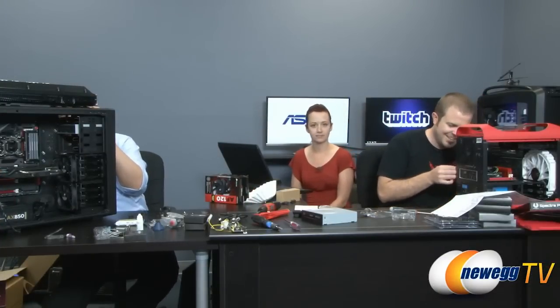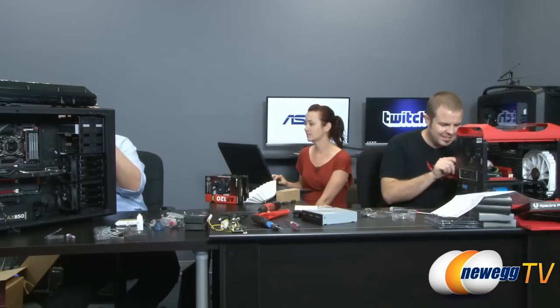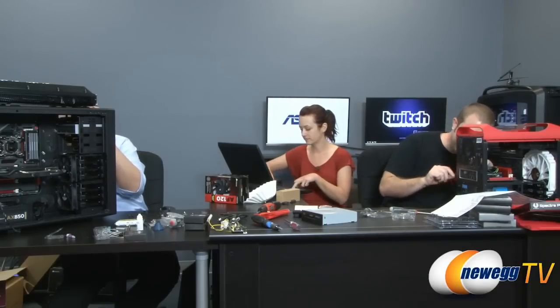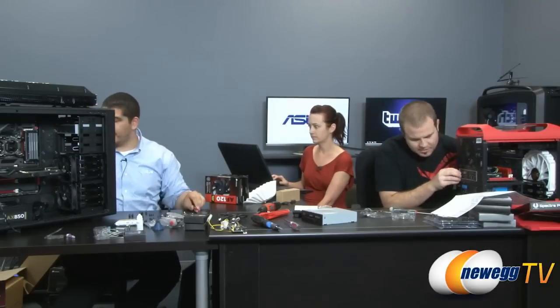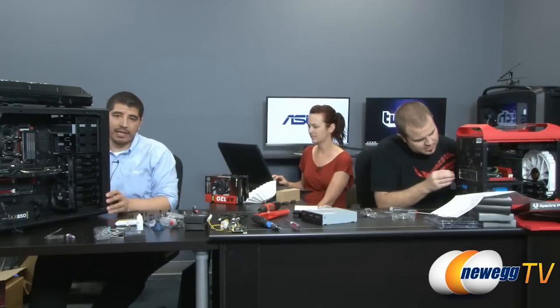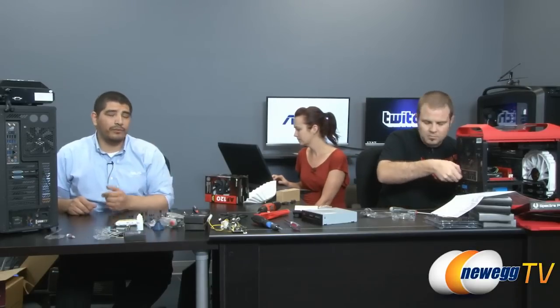But no, Paul makes a pretty good point. In most situations, you're not going to get a huge impact. But depending on your work usage, DRAM really affects a lot of bandwidth-based items. And if you're doing a lot of decompression and compression, so if you do a lot of photography work, doing a lot of heavy batch conversion, compressing down files, extracting files like that, you can actually have fairly sizable increases by going from like 1600 megahertz to like 1866 or 2133, even 2400 memory.